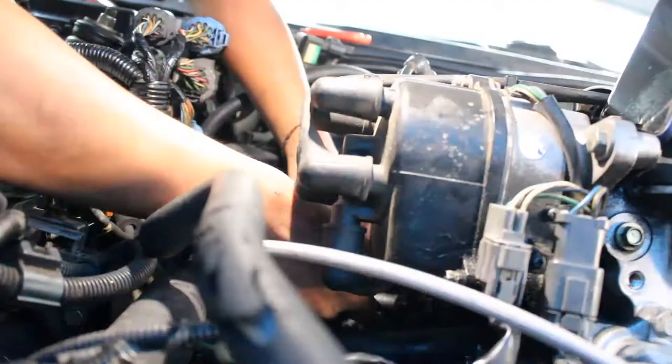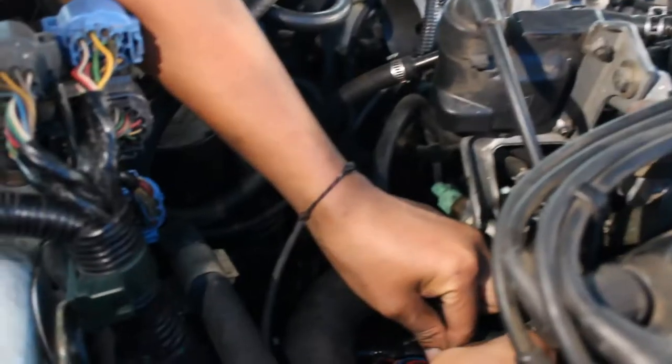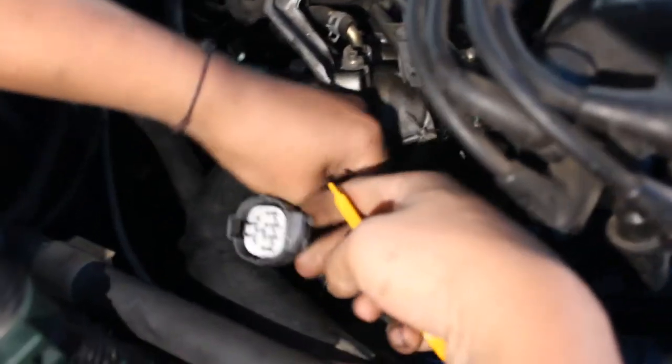All right, so we're gonna start the wiring. According to the video, it's gray with the red-white stripe together. We're gonna do that first. Okay, that's gray, right? Yep, gray and then red with the white stripe. And then you can put the black together, black with the blue stripe. Then you solder those three together, or electrical tape those three together. So these are the power right here. You got the gray with the red, and black can be optional. So red and gray have to be together, and black is optional.